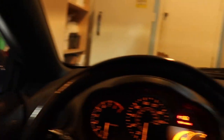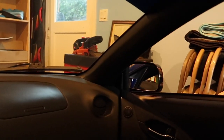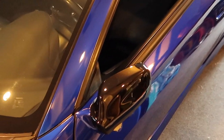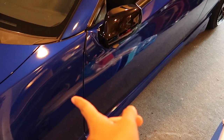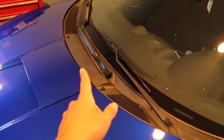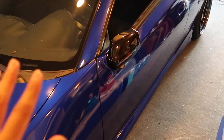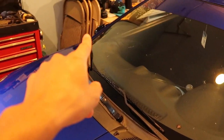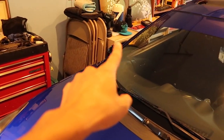But yeah, here it is — it's the finished product. Hopefully this wasn't too confusing, but it's pretty straightforward. You're really just adding two wires. The most difficult part is probably routing it through the door, that little area, and then going all the way through to the other side and then through that door. But other than that, if you guys do mix up the two wires, just switch them around, because that did happen on that side where I accidentally had them flipped. So when I went to go close it, that side would open up, and when I went to open it, that side would close.